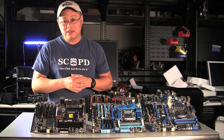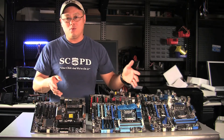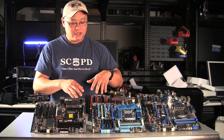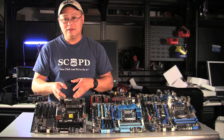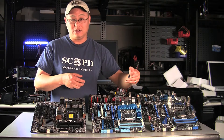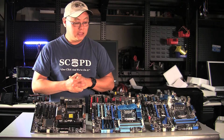Also, the I/O is a little better on the SATA 6. We'll be looking at more USB 3 performance issues now that we have the new e-TRON board. I just wanted to give you an idea of what you get, because a lot of people ask what they're getting for $300 vs. $180 vs. $250. Obviously ASUS and MSI have different boards at different ranges, but this gives you an idea of all the extra features — they just keep adding features. Like the ASUS board gives you front-mounted USB 3 and all the Bluetooth stuff, while the Gigabyte gives you the NF200 chip and USB hubs. On the MSI board, I think it's a great board for the money. For $180 you're getting a lot — four SATA-6 and lots of USB 3. And frankly, it's nice to have the option to run three GTX 580s, but if you're on a budget, are you really going to be running three 580 cards? So I think that's a great board for the price.